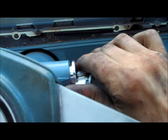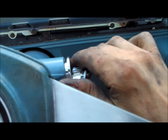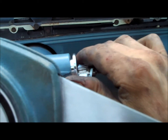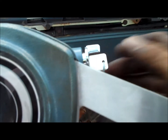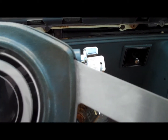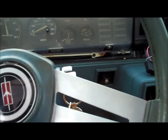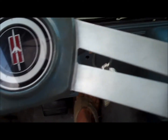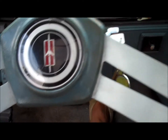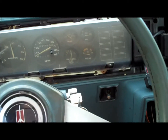It's been sitting for six or seven months. I put some gas down the vent of the float bowl. Let's see if this car fires up. It's cranking... it is running like shit, but it's running. I still want to do the compression check to figure out why it's running on seven cylinders or less. The buzzer won't stop because the steering column is jacked up — someone pulled this column apart and didn't put it back together right.